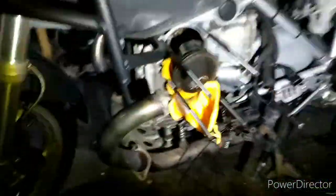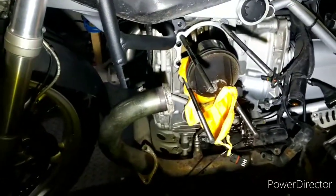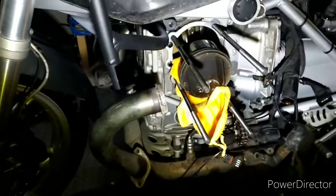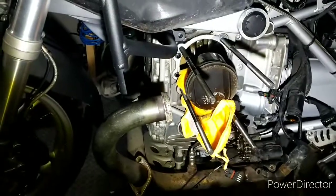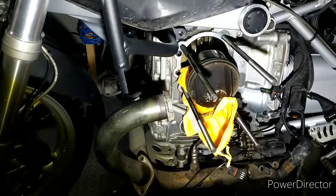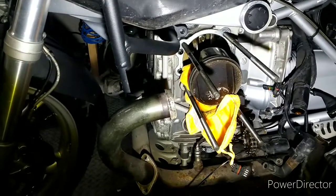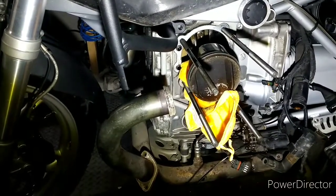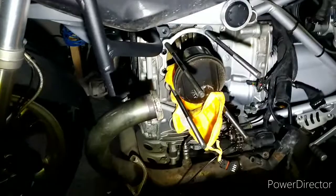I've removed the cylinder now. For those of you more in the know, don't worry about the massive pry bar - I was extremely careful, just gave it a very careful pry away from the block and it's come out. Everything inside - the conrod which connects the piston to the crankshaft - is solid as hell, it all looks good. Even the rings look good, which means I don't think anything got down into the piston liner. It's just the piston that's chewed up, which I'm going to replace anyway.